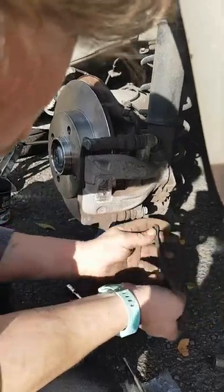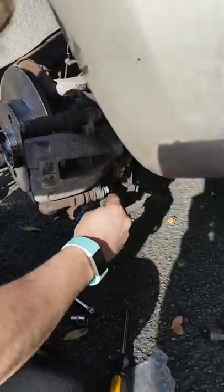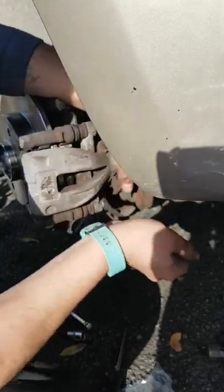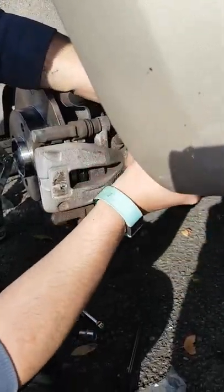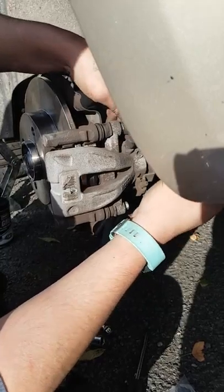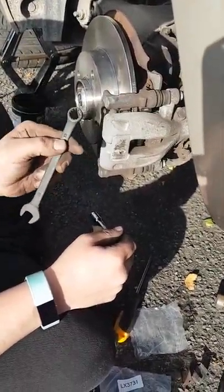Just pop your two bolts back in there. I had to rewind the caliper so I had to stop the video. Just watch these stay in place while you tighten it up. You can do these up to a specific torque if you choose to — I've always found they've been perfectly fine just tightened up. Now the bolts they give with it are 12mm but the standard ones on it are 13mm.